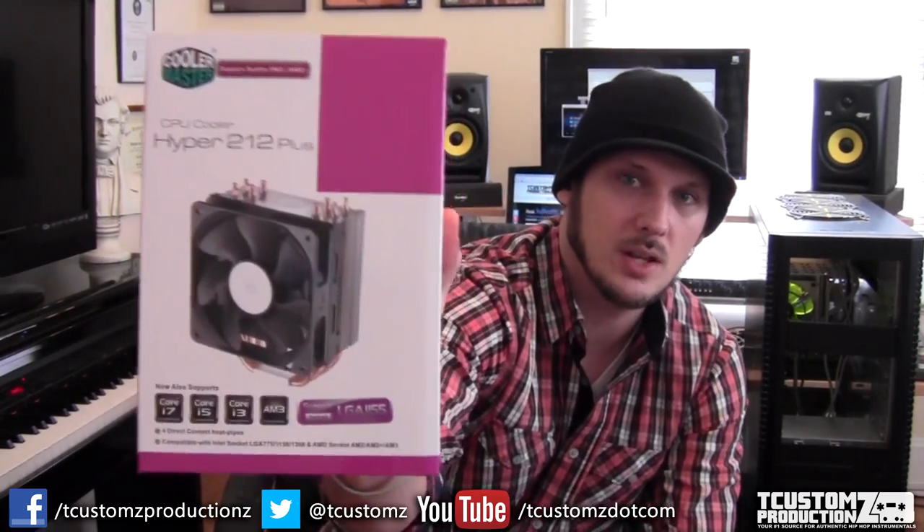First up is the processor. Some of you were asking if I'm going with AMD or Intel. If you saw in the last video, I actually had an AMD motherboard. This is an older processor — it's been out for a little while but has really great performance reviews and has the capabilities for overclocking, so I'll get a little bit extra out of it. I did some price and performance comparisons with newer processors in this same series but ended up going with this one — the FX8350, 4.0 gigahertz stock speed, 8-core processor. Now, a lot of times the stock heat sink fans are not great quality, so it's usually recommended to upgrade to an aftermarket heat sink fan. I ended up going with the Cooler Master Hyper 212 Plus. It's compatible with a lot of different socket processors, and I highly recommend it — it has tremendous reviews online especially for the price point — just to make sure I keep the processor cool when I do overclocking.